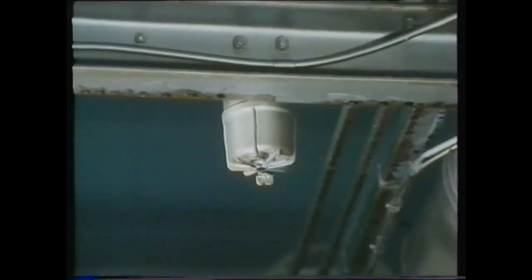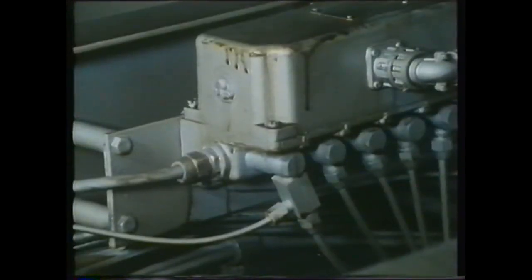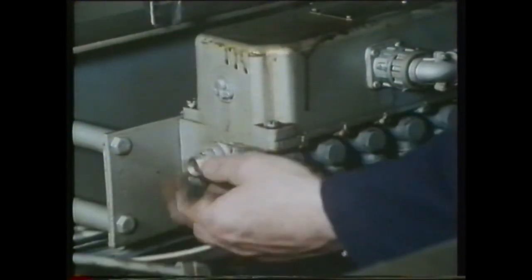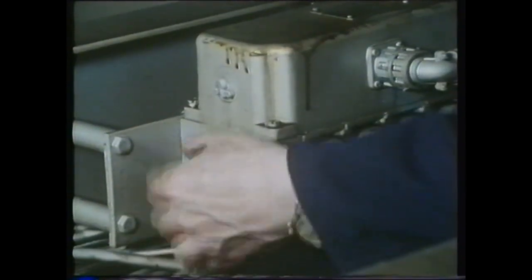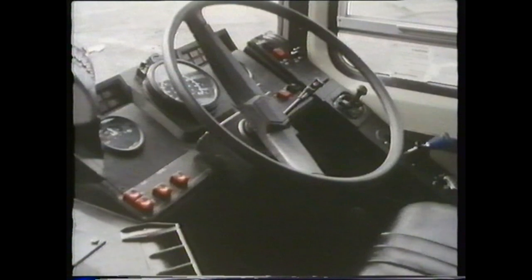If the drive to the rear axle is in order, then the fault may be found to be in the area of the air supply to the gearbox, and the problem should be approached in the following manner. Check that the auxiliary air tank is fully charged and that it's providing the correct pressure to the EP unit through the limiting valve. When you slacken off nuts in any air circuit, the presence of an air supply will be audible. But when you're completely releasing nuts in the air circuit, always empty the air tank first. Having established that there is an air supply to this point, the air filter should now be removed and examined to ensure that it isn't blocked in any way. If there is a correct supply of air to the EP unit, then it may be that there's a fault in the power supply which prevents the operation of the solenoid within the EP. On some vehicles, the gear control is linked electrically to the starter system and therefore the engine won't start if there's a power failure. On vehicles with this type of change speed control, the warning light won't illuminate if there is a power failure.